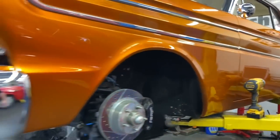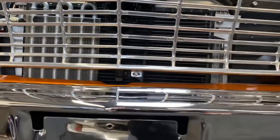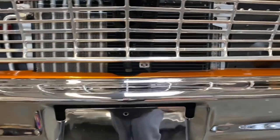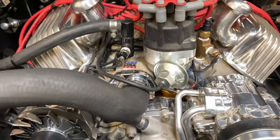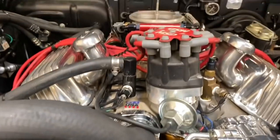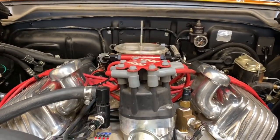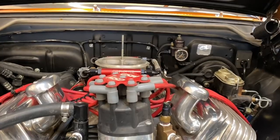One of the issues with the Falcon was temperature — that was the biggest issue. The problem was so much hot air in the engine compartment, and then even more hot air with the fans pulling through the radiator, superheating the air. There's an air intake right where the air cleaner would be, sucking that hot air into the motor and just wasting horsepower. Hot air is bad.